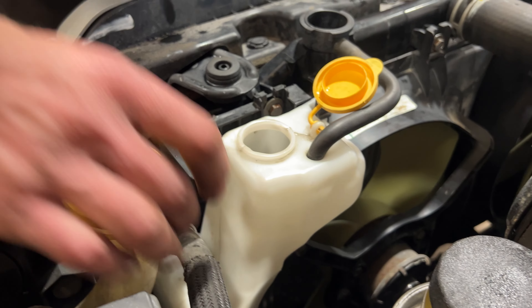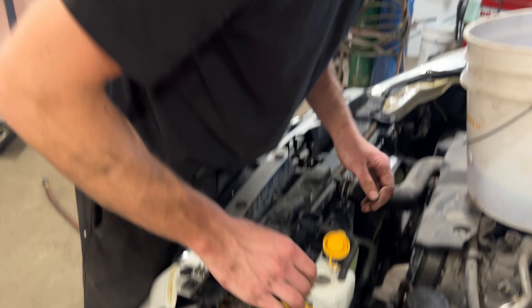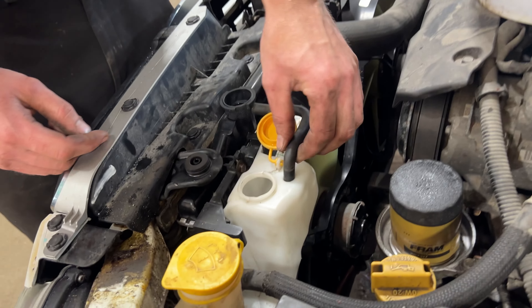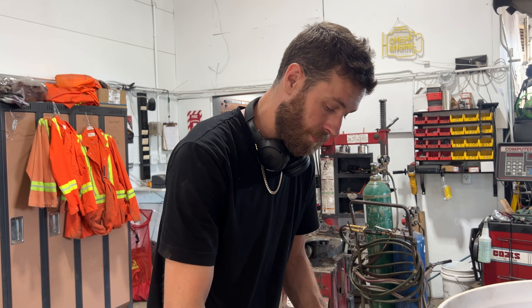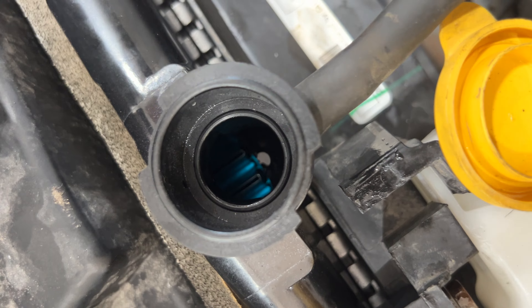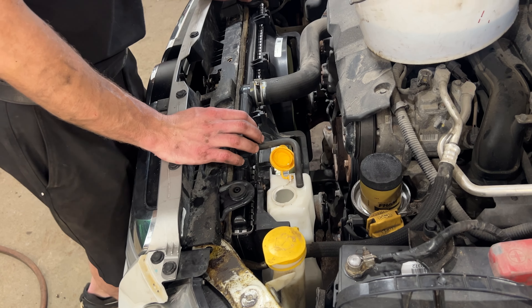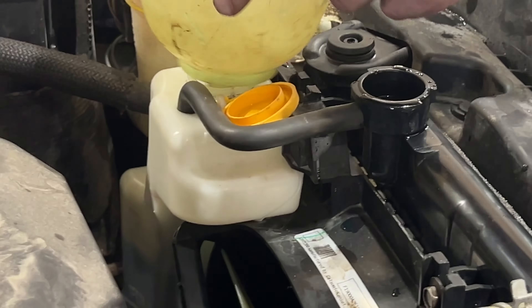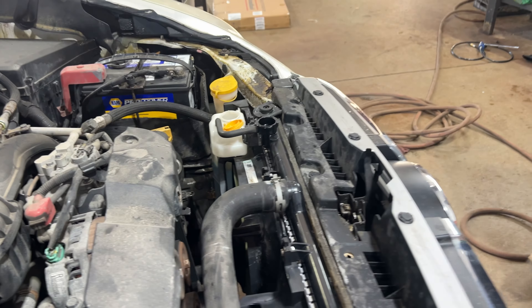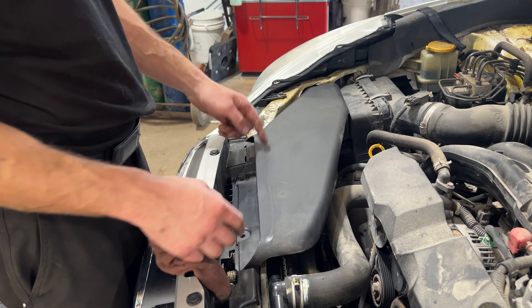The transmission cooler lines have spots on the bottom of the rad to secure them so they're not hanging. Pop those in and plug the rad fans in. The overflow reservoir is fairly simple — there's just a pressure tab, push it and it pops off, then slides out and comes up. The hose's long end drops in, curves over, and connects to the top of the rad. After vacuum filling, put a funnel in the top and fill it the rest of the way. Once topped up, run it, check operating temp, confirm no leaks, then fill the overflow reservoir to maximum.